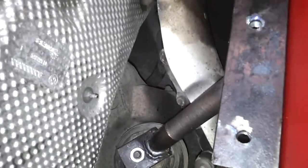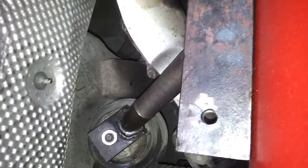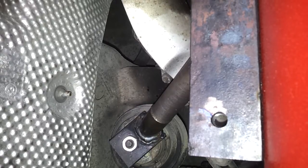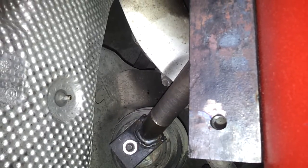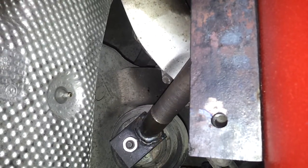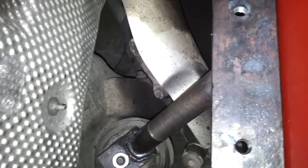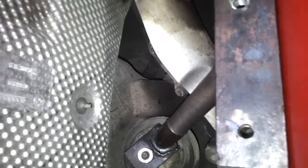Up on the top, we have two holes drilled 10.5mm. On the back of that, we have a welded M10 hex nut — done in two places on this mounting, and the same on the far side.